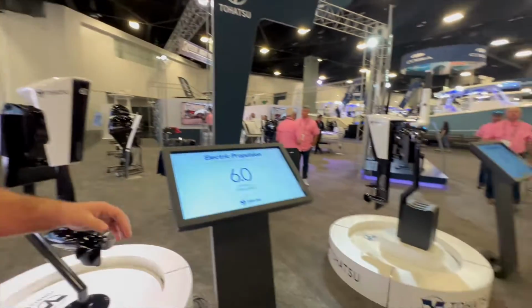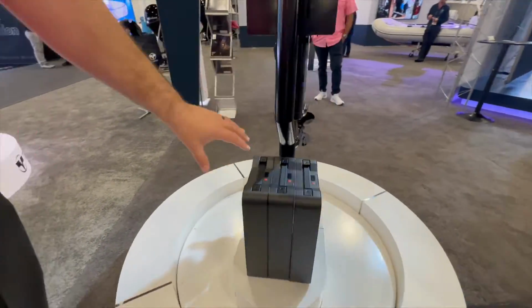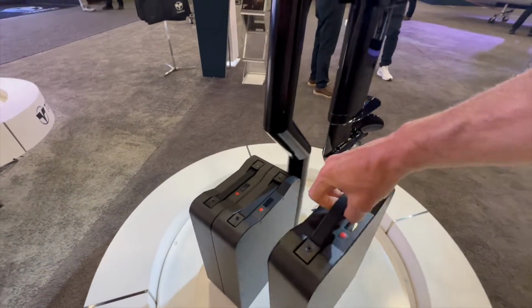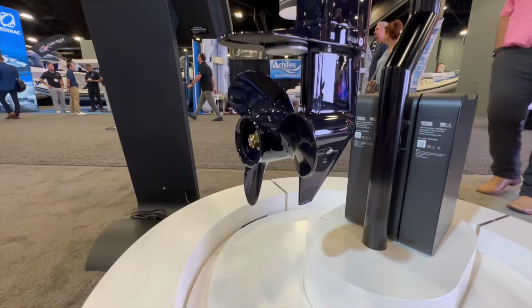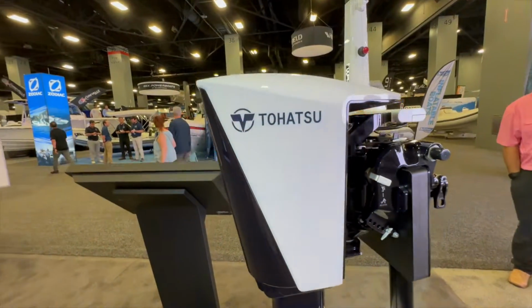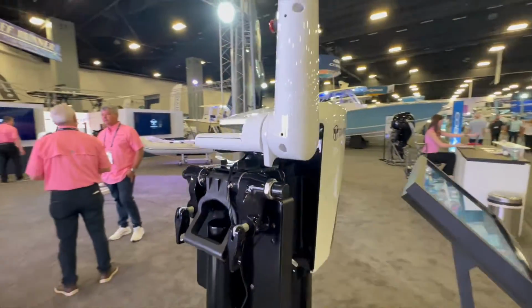Okay. So this is a battery pack concept for the 4.0. This is somewhat like a 3-gallon fuel tank, so we're playing with the idea of these for those. Now, both of these, 4.0 and 6.0, are what we call battery agnostic. It's a 48-volt system, but you're not required to use a specific battery. Okay. So lead acid, lithium ion, AGM, you can pick the battery supply you want that fits your price point. So we're not forcing you into a specific price of a battery.